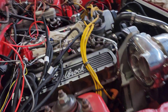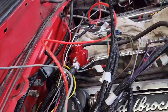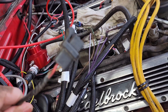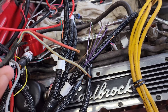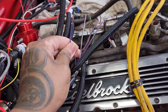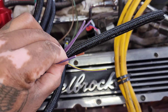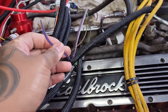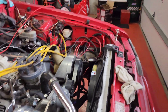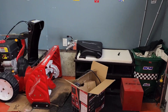The other side of that: here's my stock IAC — the original Ford one that came on my vehicle. Basically, the purple and blue wire and the purple and yellow wire are the only ones that are going to be used. Now that the ECU knows how to communicate with it, it's going to be able to run and function with my current setup. Danny at MF Customs has a lot of these things set up ready to go, and if you're in the States it'll be a lot easier just buying the parts you need.